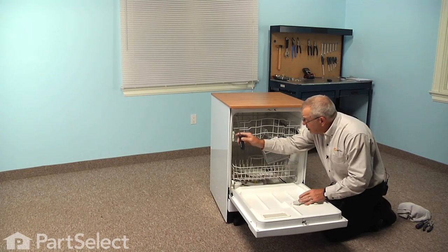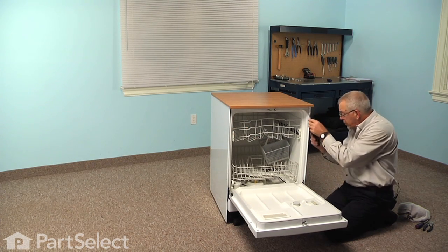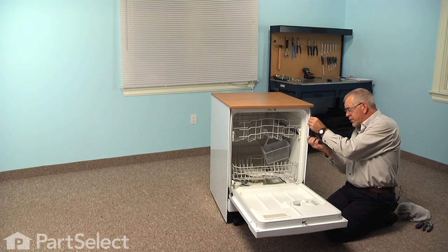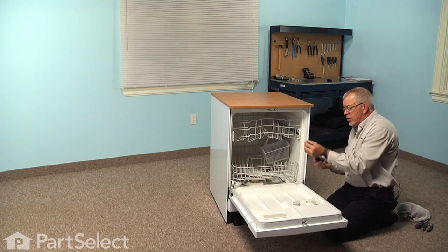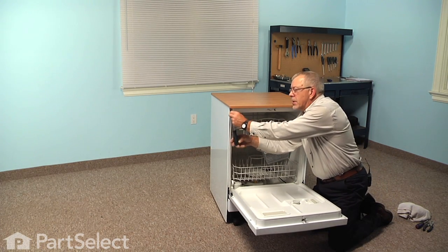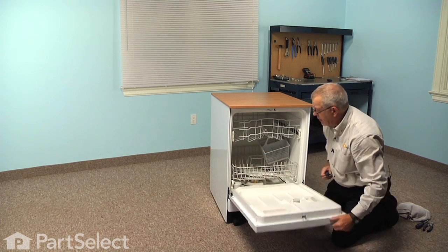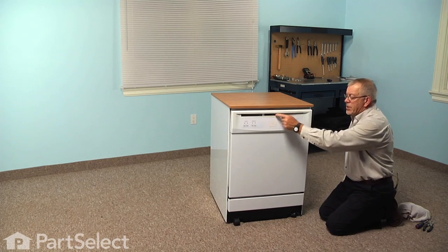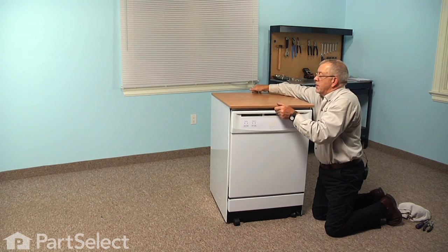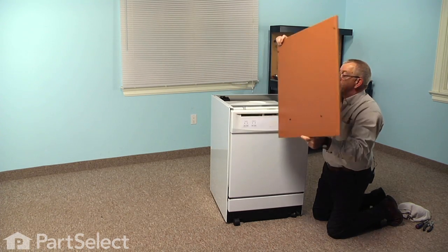and we're going to remove 2 screws that go up through these mounting tabs attached to the cabinet that hold the top in place. Our Phillips head screw, let's just remove both of those, and make sure we reuse the same screws so that we don't inadvertently put too long a screw in there and damage the top. Close the door and latch it. Then you can pull that top just forward a little bit. And that will unlatch it.